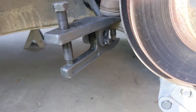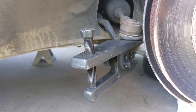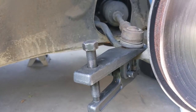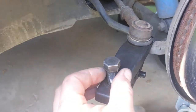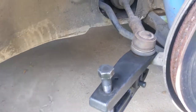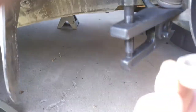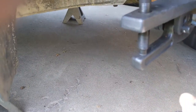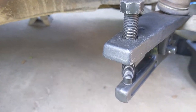There's a tool to do that. Some people use hammers — don't do it. You can rent this tool from AutoZone or buy it on Amazon for about 15 bucks; it's just not worth messing around. Slide the tool in there, tighten this bolt down and it will pop the ball joint off. I highly recommend that you take the nut that came off out of the equation — it'll make quite a bang when it goes off, but you'll hear it.